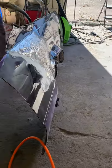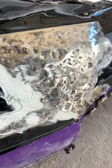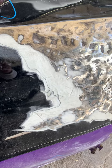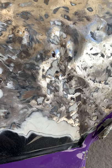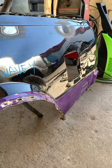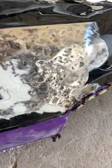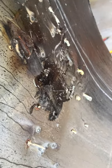This was the old skin. Started to grind into there, found a little hairline crack, and this is what was underneath — about a half an inch of Bondo and a bunch of holes. As you can see, you can look right through that thing. Whoever did the body repairs before just popped holes and didn't fill them and put a bunch of filler in there. If you look behind it, you can see all that Bondo dripping through them holes.